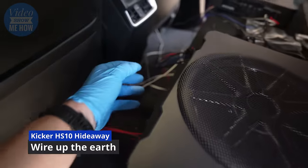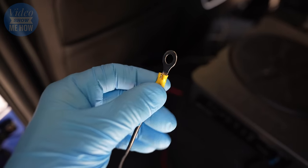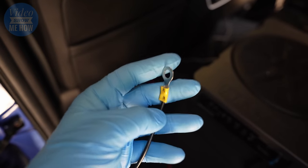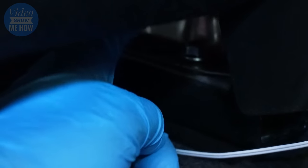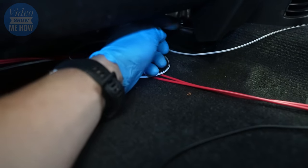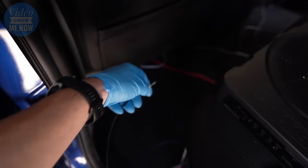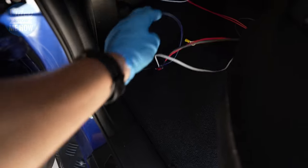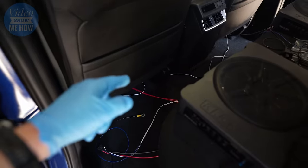We've got both units ready to go. The final bit we need to do from a wiring perspective is earthing. This will very much depend on your install and where you're putting it. You want to find a bolt that's bolted into the body for a really good earth point. For us going into the D-Max under the front seats, underneath there is a bolt — I believe it's 12-millimeter, maybe 13 — that clamps the seat to the seat rail, which is then bolted to the car. From here, bolt the earth into position, trim up the remaining blue cable, and heat-shrink everything so it's protected. Once it's all tucked away under the carpets, reinstall your car mats and get ready for a test.